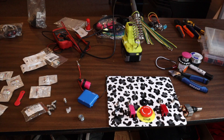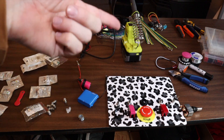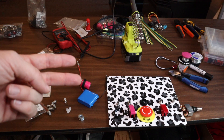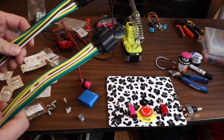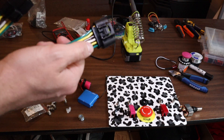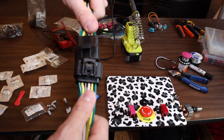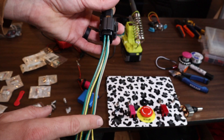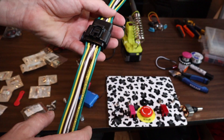Everything we're going to be using for this toggle switch panel I'll leave in the description below. The important part of today is I want to talk about a few things that people don't mention when building toggle switch panels — things I've ran into that don't always get onto camera. Building a toggle switch panel is pretty easy: you drill holes and put your toggles in. What I want to talk about are the pigtails I use and the spacing. This is the wiring harness — I actually built these. It's a 12-pin, six on each side, matched from side to side: in and out, in and out. Depending on what toggle switch you're running, you'll have power in, it goes to the toggle switch, and power back out to whatever item you're running — or ground, or over to a relay.